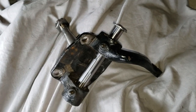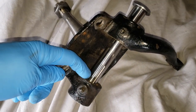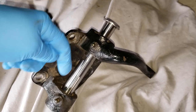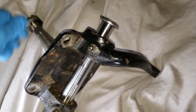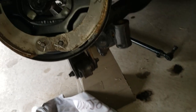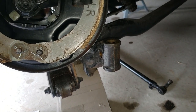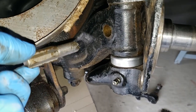I have my reconditioned spindles back along with a new kingpin. I had a professional put in new bushings and align them all the way through so it fits perfectly snug — no slop at all. Now we have to reassemble in reverse order. Let's take a look at how that's done, starting with the lock pin.